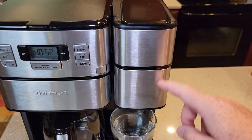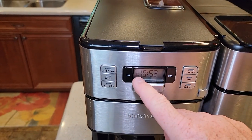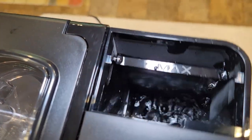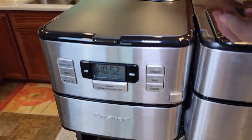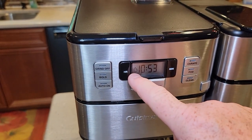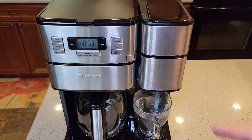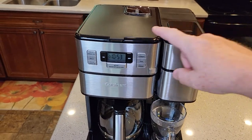If this doesn't fix it, I would try cleaning that needle four or five times and doing fresh water rinses between each one. Make sure your add water light is not on — that little drop of water icon means you're out of water in the reservoir. There is a float down in there that activates that sensor, and you may have to jiggle that float to get it to work, because if that light is on you can't press the pod — you've got to add water to get that light to go out before you can do a pod. Check out my next video on the clean light — I'm going to show you what to do if the clean light comes on. It's only for the coffee maker side. They did not add a clean light for the K-cup side, but I am going to show you how to descale the K-cup side and the coffee maker side.